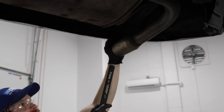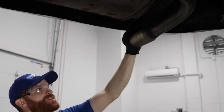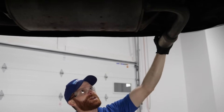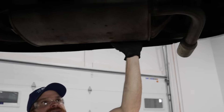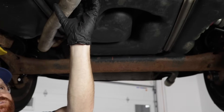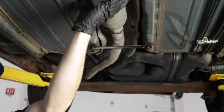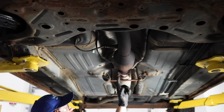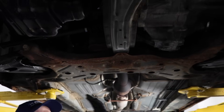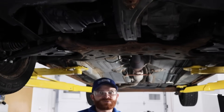When you cover it, you want to try to feel if you have any pressure. If there's no pressure trying to blow your hand off of there, more than likely there's a leak someplace. If you had a second person, they can continue trying to hold it and you could feel along any of the seams on your exhaust, follow down along the tops and bottoms of the pipes, and just feel and see if you feel any air coming through. Keep making your way all the way across to the front — essentially where we're heading right now is the manifold on this vehicle.